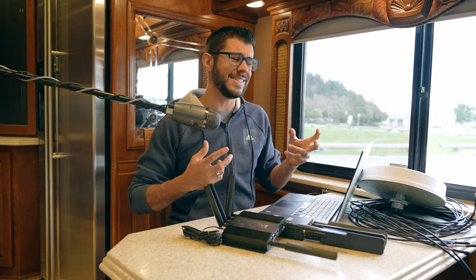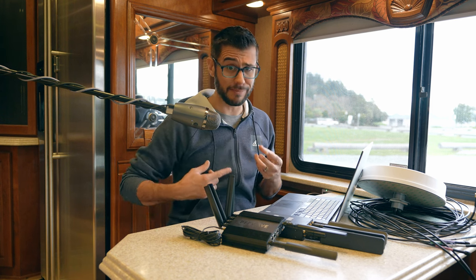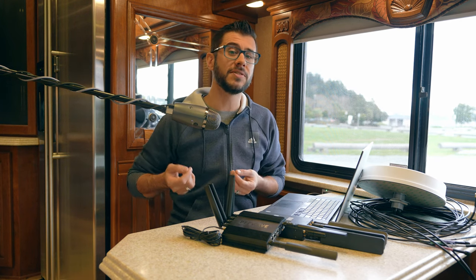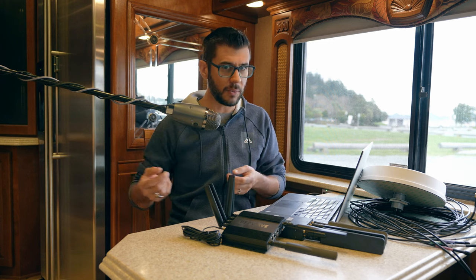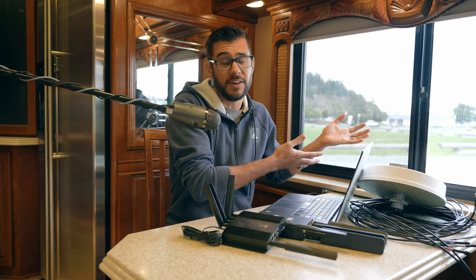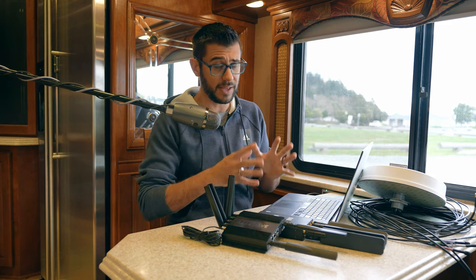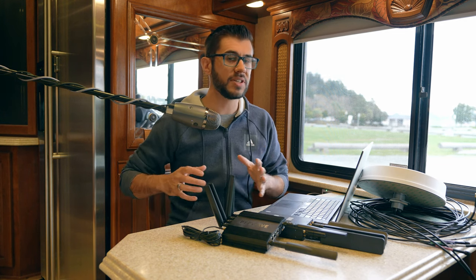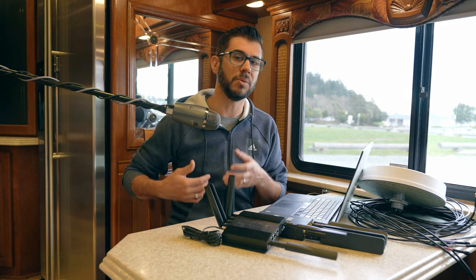Well, the fusion internet is through a VPN. And what we found is that if you're trying to stream video, a lot of streaming services, Amazon Prime, Netflix, etc., don't like when you connect through a VPN. And I think the reason for this is that people have been using it to basically get around geo restrictions so they can be in another country and they can watch content from yet a different country. So they don't like it when you connect through a VPN and they can see that and they'll basically say, sorry, we're not going to connect to you. You're connected to a VPN. So you have to drop the bonded network for those certain applications. However, most of the time using the bonded network is going to be more stable and more solid.